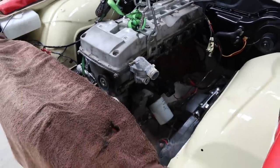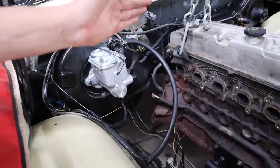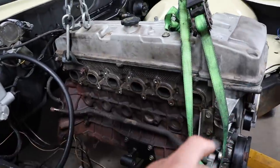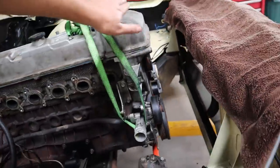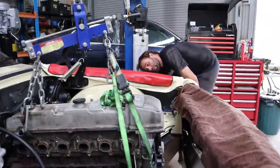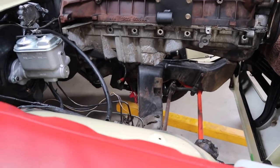Very tall, the old Barra. Looking pretty good though. Based on our measurements, we'd set the Barra based on where a Turbo 400 would normally mount on an H-series cross member, measured back from there and put the mount pretty much straight over the top of that mount. Due to the lack of room at the front of the engine, there are many advantages to moving the engine back as far as possible — firstly weight distribution, and the further back it goes the higher it sits on the bonnet, giving us the most clearance height as well.